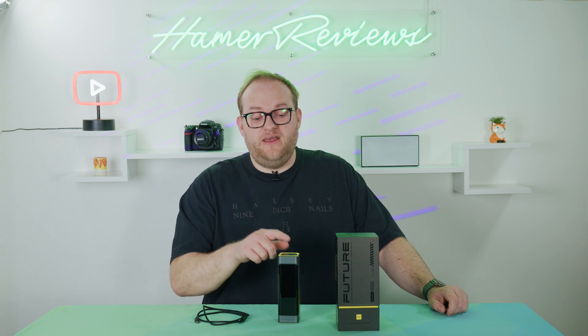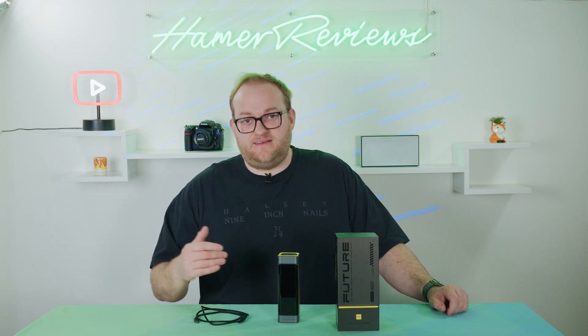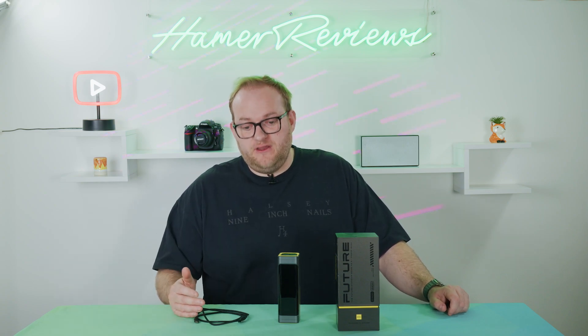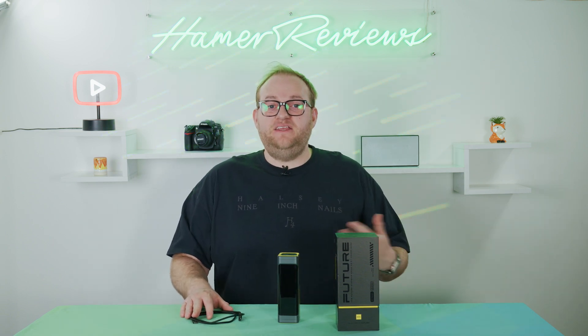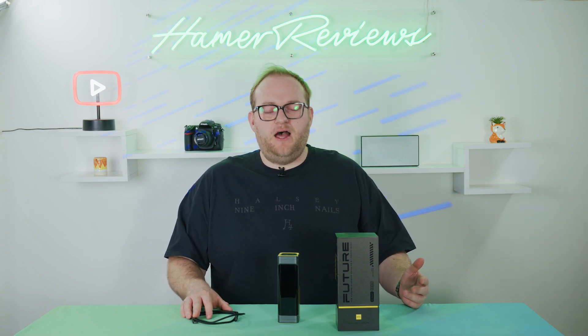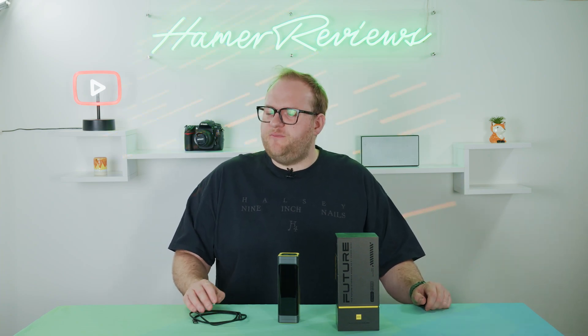However, if you have a really old USB-C cable, you might even be limited to 30 watts, meaning your max output would be somewhere around 170 to 190 watts rather than 240. This isn't going to affect everyone, and if you have devices that draw that much current, chances are you probably already know about USB-C standards. Thankfully, USB-C cables have got really cheap, so even a fast charging cable is relatively affordable — but it is something to keep in mind. Most of my USB-C cables handle 60 watts, but a couple are limited to 30.